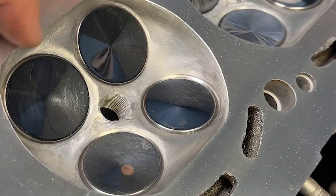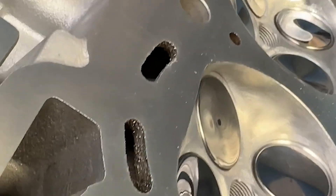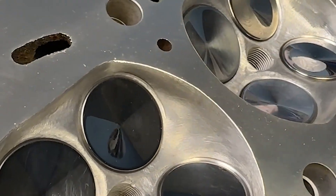That squish area is on every cylinder head. The combustion chamber in this head was not made to be gigantic, and there are no pistons that are going to make up for the difference. So what does Head Games do? We just lay the combustion chamber back — we don't remove it. We actually won't remove it for anybody, no matter who you are. You're not going to come to Head Games and ask for that, because I have this theory that it doesn't work.